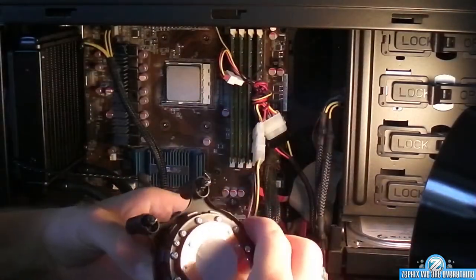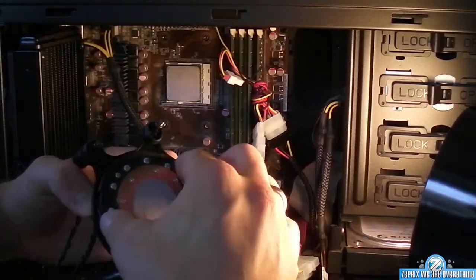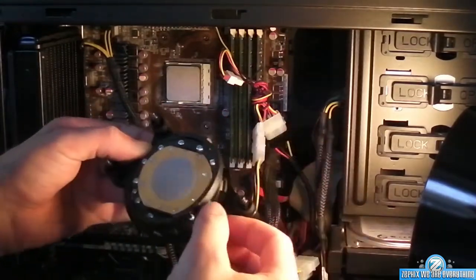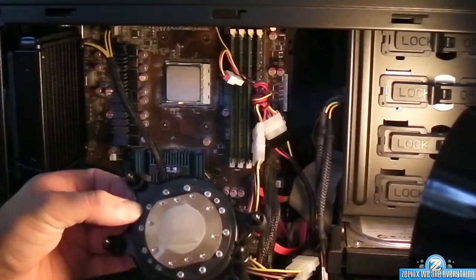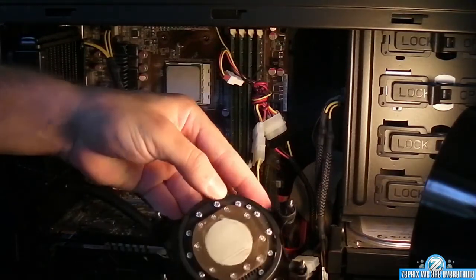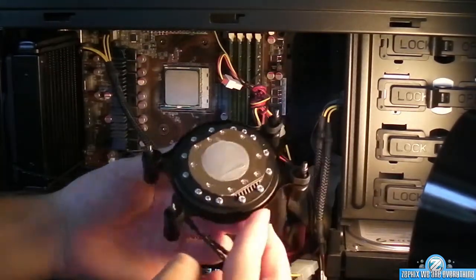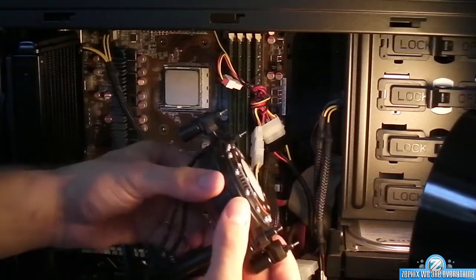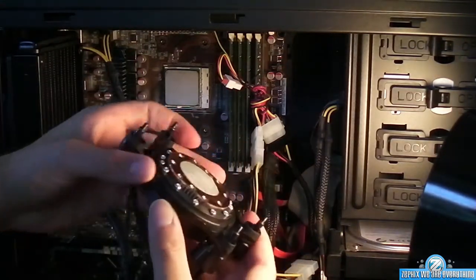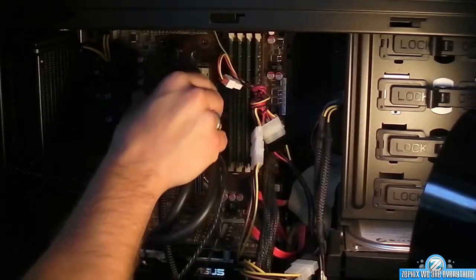What you're going to do is snap this into place using this other O-ring - this goes in here. I snapped them all in and now it won't move. This seems to be different than the previous year's model. You used to have to put the bracket on here and loosely tighten it, but now it's different. So now we're going to push this right onto the chip and then tighten it. The back plate wasn't popped in for some reason - now I'm going to tighten all this up in an X pattern. That was an ordeal, only because it's different than the video I had watched.